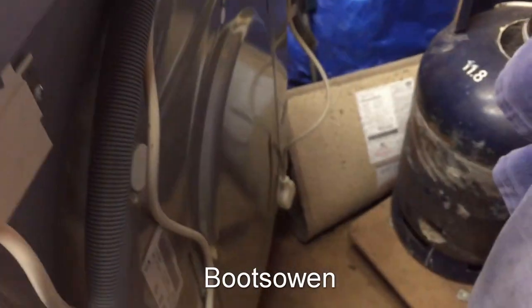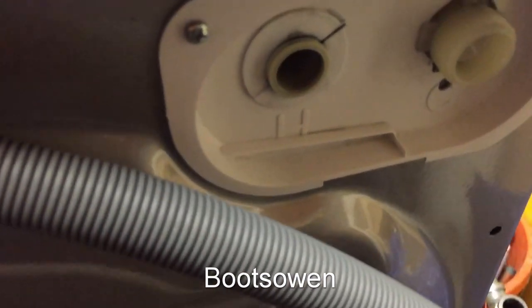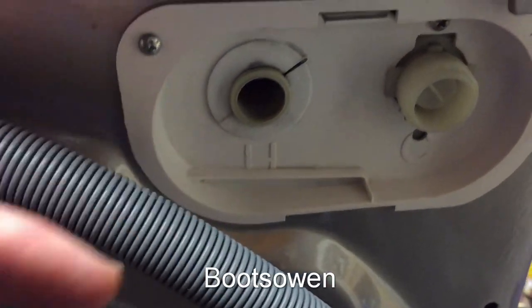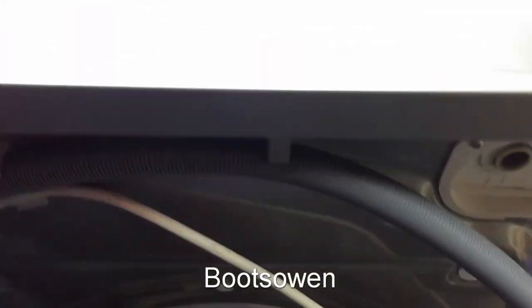Around the back — I've got it up on wheels but it's still heavy. There's a plug, waste hose, and some information here. I think it's 2009, made in Italy. Does that mean it's Merloni? There's a piece of plastic here presumably for a machine that had a hot and cold fill because it's marked H and C, but this is cold-only fill. There's a little thing to hold the plug down — three holes punched in it. The top is held on with two screws as usual and pulls back.